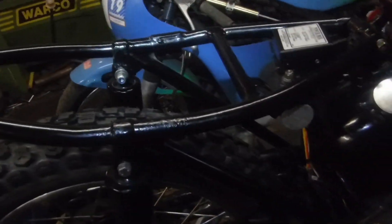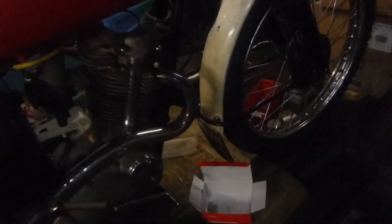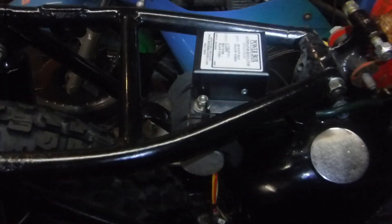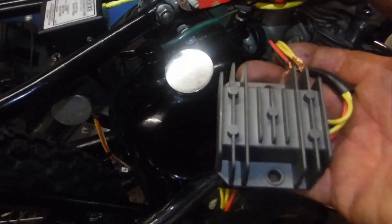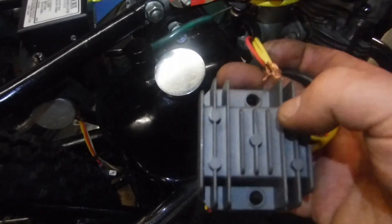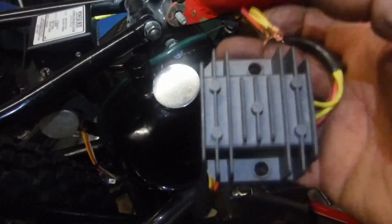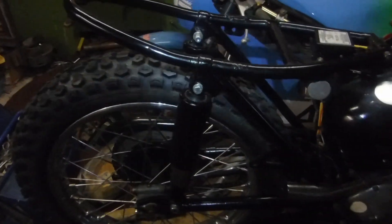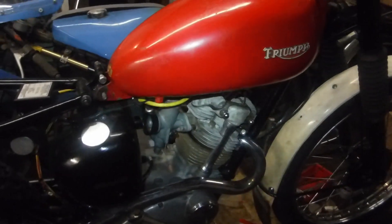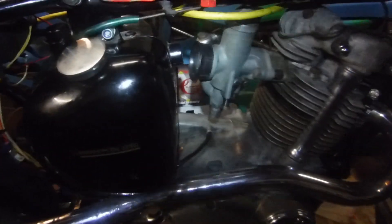The mudguard should be back in a couple of days and I'll be able to refit that, then the seat, and then we really will be able to possibly consider trying this thing out moving under its own power. I feel like some real progress has been made today, and I've learned something — certainly there's nothing wrong with the output from the alternator. As we saw, we've got a first-kick start running nicely with the capacitor unit — but with the other type and no battery, no chance. I've changed my mind now that I opened a brand new one today and it did exactly the same, so they must need a battery to work in conjunction with them. But the Sports Cub — Scrambles Cub, whatever you want to call it — has inched even closer to the day where we'll go roaring up the lane and unleash that full 14 and a half brake horsepower on the world.